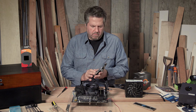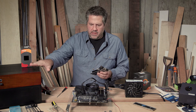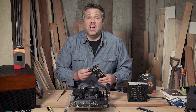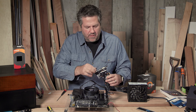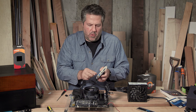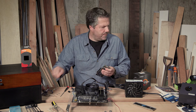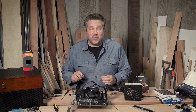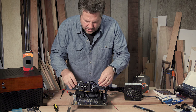This is a basic entry-level graphics card. We're going to modify it so that it can fit in a half-height slot for this case. To do that, I just take this screw out — and try not to lose it in case you ever need it again. I also need to remove the port covers and retainers. I'm not going to need the VGA port, so I can leave that. For the DVI port I take out those screws, remove the full-height cover, put on the half-height cover, put the little retainers for the plugs back in — totally lucked out finding that tiny screw, migraine averted — and then tighten it down and install the video card.